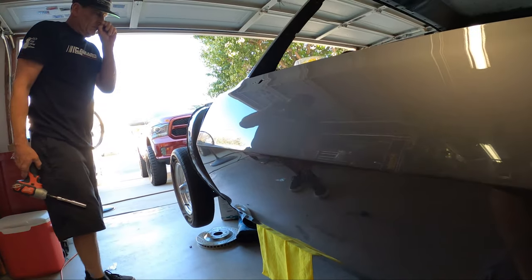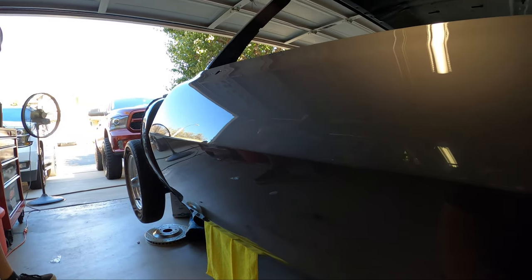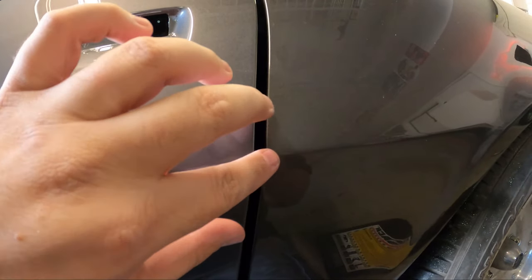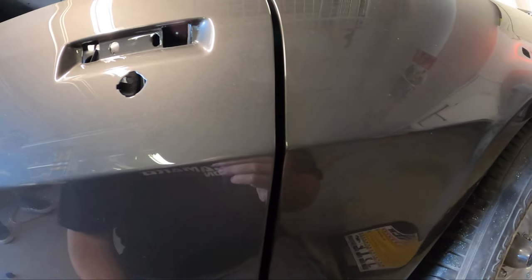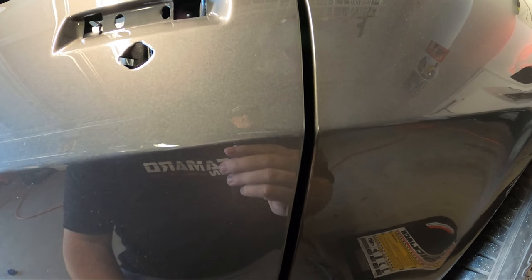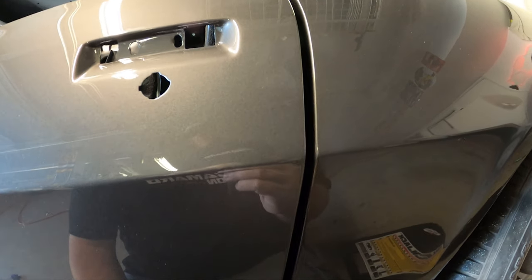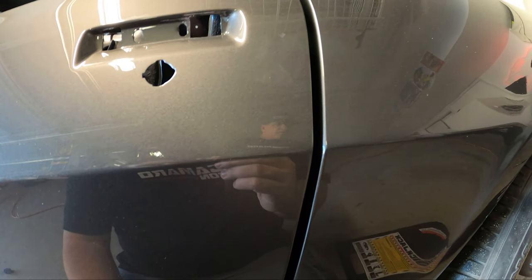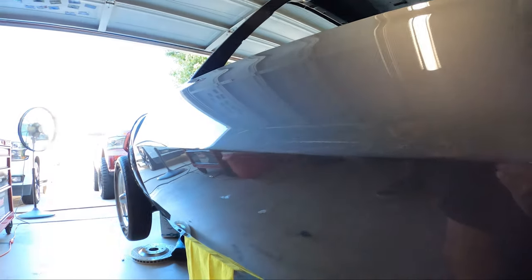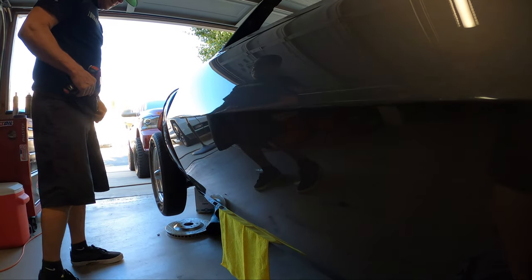All sorts of fun with the driver's side. Right now the door's too far forward — we have a nice big door gap in here. We need to bring it back because this gap should be about a paint stick width. Right now it's about two paint sticks, so we've got room to slide it back, and that's what's happening next.